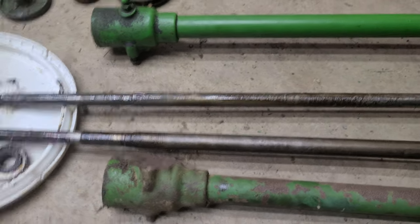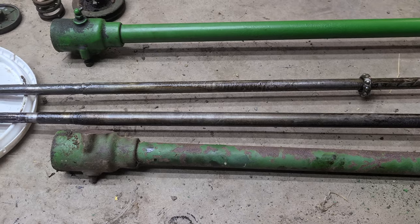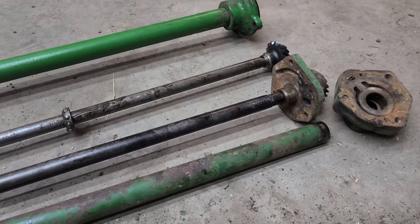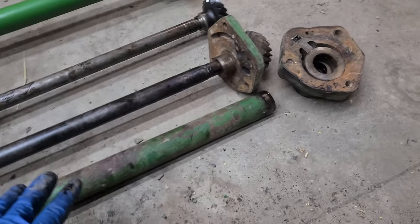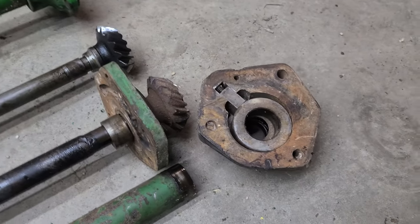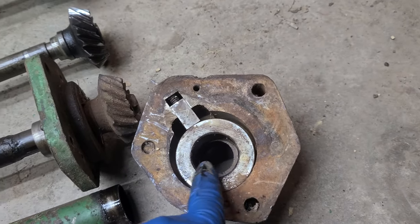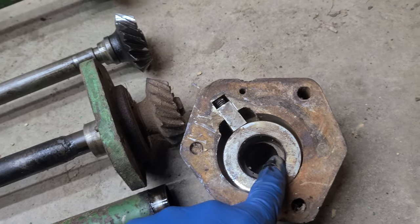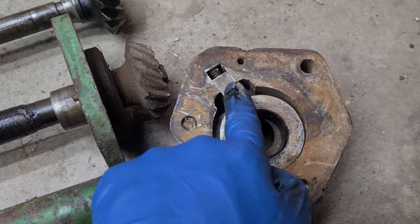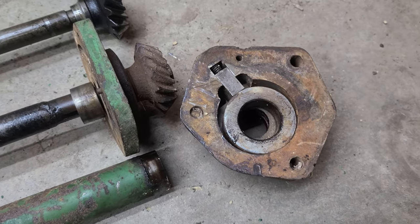I have both of these apart and haven't ordered parts yet because I wanted to see whether I needed a spacer on the front of the shaft — that's what most people talk about. This newer shaft has the air pump in it. How this works is this piece sits on the shaft and it's eccentric, so as the shaft spins it takes this ring and presses it up and down. There's a spring here that I think lets air into the engine.